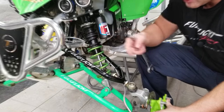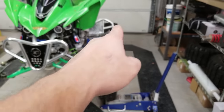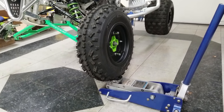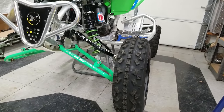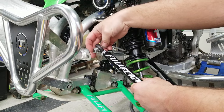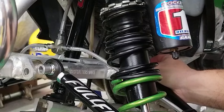I'm going to throw a tire on because that makes it easier to eye this thing up. It's just a slight bit of negative camber - if you use the back tire as a reference, you can see it's just tilted in just a little bit. I've got the jack under here to simulate having the quad on the ground, because all these bolts are loose and that takes the play out of them so it'll be more accurate. I'm going to adjust on the inside here - I'll remove these bolts and do about one and a half revolutions. Small adjustments sometimes make big differences on stuff like this. We are at four and a half turns out from the inside - I wouldn't go anything past five full turns.